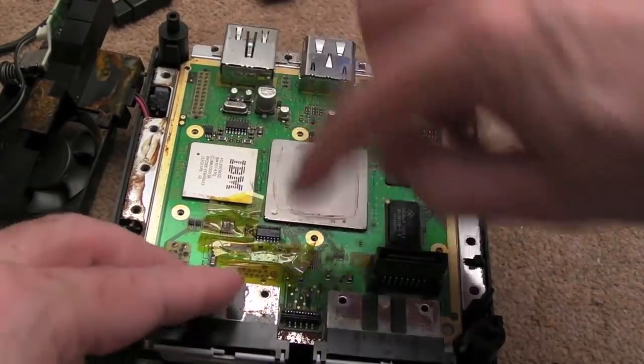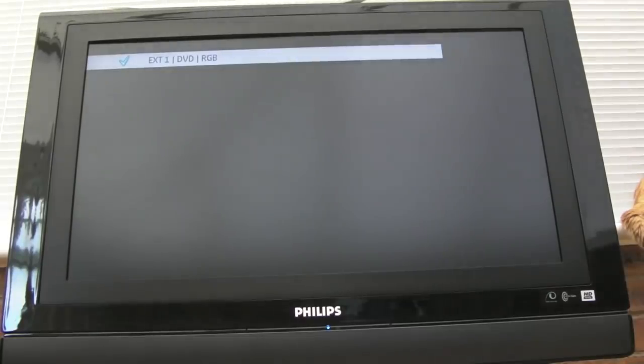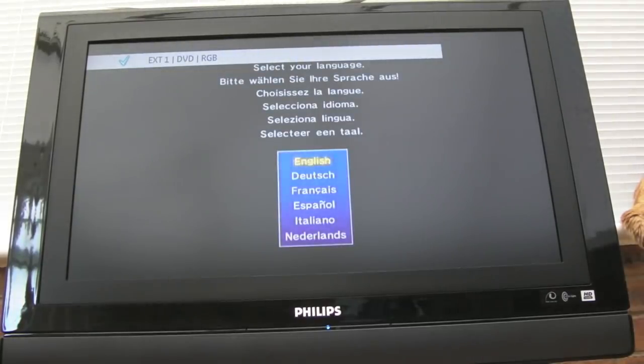I seriously doubt it will work, but let's power it on. Same thing — no video, the video's gone. Exactly the same as it was in the previous video: you get video and then you lose it, like it's had a crash or something. So all is not lost in terms of the learning process — we've got the other BIOS on this one now, the other real-time clock chip. Just testing this: in theory you should have the heat sinks on there, but just for a split second it's not a problem testing without the heat sink — they don't instantly go 200 degrees. So switching this on — it would seem that chip is not the fault on the other one.